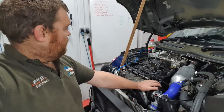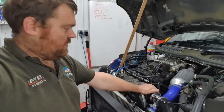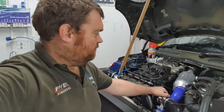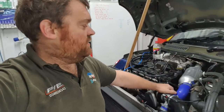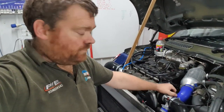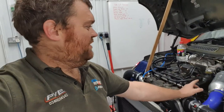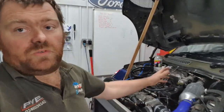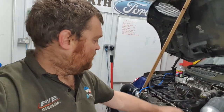What else have we changed? We've also changed the exhaust. Previously we had a three-inch downpipe from the turbo and we just joined that in to where the original exhaust was — it was some sort of performance type exhaust but it was obviously just crap. So we've now made like a three-inch stainless pipe right the way through, with a back box. We cut the battery tray out and put a back box under there. Thanks to John and James for the bits and pieces that allowed us to do that. We've now got a three-inch exhaust all the way through instead of being reduced to the smaller one.